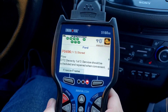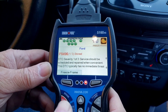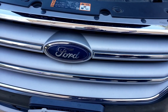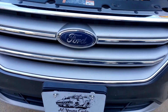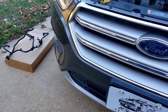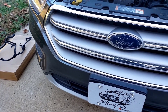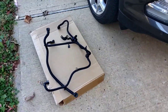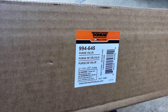It's a P0496 - I'm going to show you what that is. It is a purge valve connected to the engine. When you buy the aftermarket one it comes with a bunch of hoses. We're going to change the vapor canister solenoid, or purge solenoid as they call it. We got it from AutoZone - this is the Dorman brand. There's also a Duralast brand; the difference is like 60-70 dollars. This is the only one they had because it's on back order worldwide.